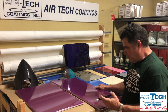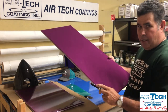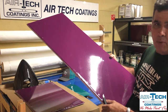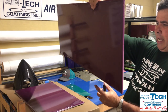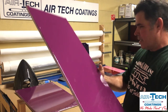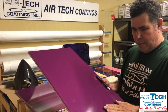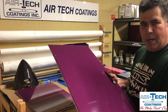On this sample I can get a hold of this paint — I've scratched at it and it looks like it is adhering pretty well. This was painted yesterday morning and it looks like it has a pretty good bite on it. There is a little X on it, which means I took 320-grit sandpaper and roughed this one. When you're sanding, you don't want to miss between the rib stitching — sometimes you can get a sponge-type sanding paper that'll go over them without cutting the rib. When you get up in the corners, you want to fog the primer into all of those areas.